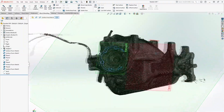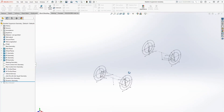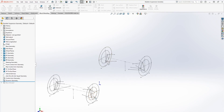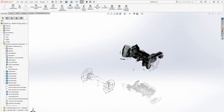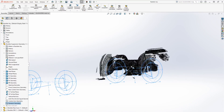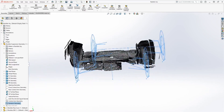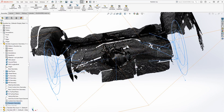The next file is the differential. I treated it the same way as the rear of the car — I grabbed reference geometry based off surface recognition. The third file is a vehicle suspension geometry template I've created. I haven't really gotten started on dialing in the suspension geometry itself; these are just nominal numbers to help me build the template as a starting point. Finally, putting all three together, I've got the vehicle template, the rear scan of the vehicle, and the differential scan. Using all that reference geometry, I was able to bring the two scans and the file together to show exactly where everything is going to go, giving me everything I need to design a subframe that houses the diff and ties the suspension geometry to this chassis.